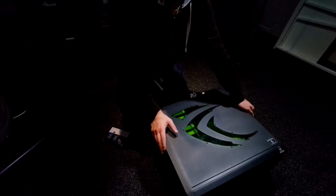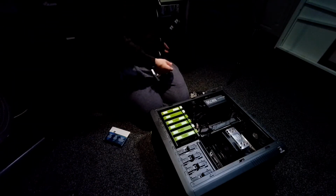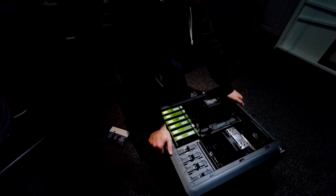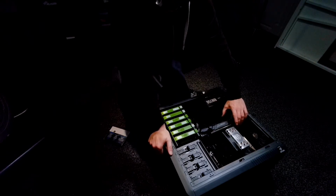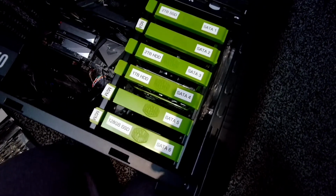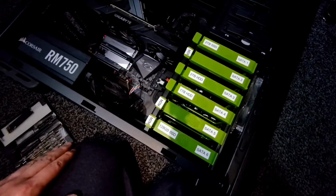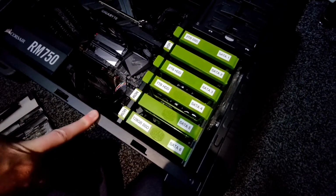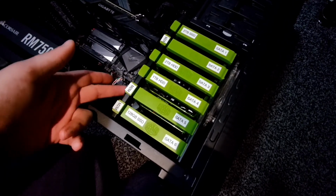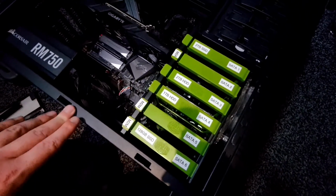Anyway, back to the upgrade. It all comes down to how many PCIe lanes you have in your computer or motherboard. I have a Z590 Aorus Master, which has 6 SATA ports and 3 M.2 ports. I actually took my time labeling these, so in the future, whenever upgrades happen, it's going to be a little bit easier. And don't get upset, I've cleaned my PC, so you don't see all the dust. If your PC is dirty, mine was dirty as well. You'll also notice that I have side labels in here, which are M2M, M2A, and there is M2P, which I'm not using for a very different reason.